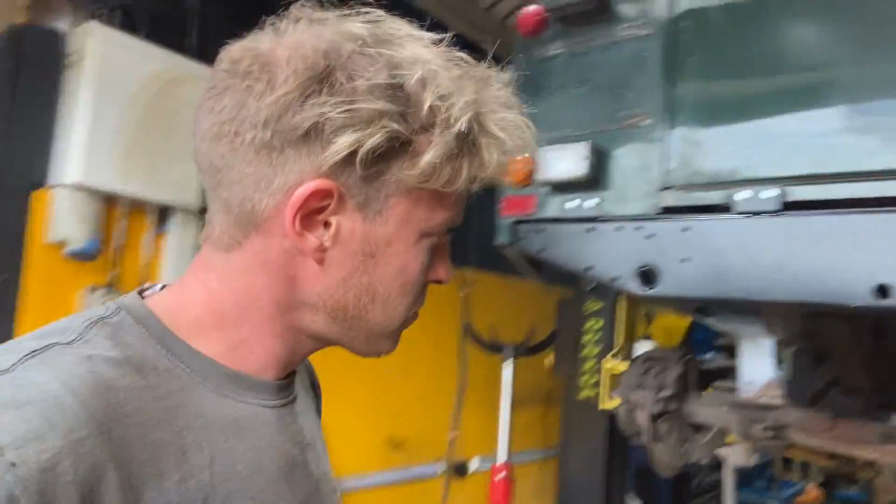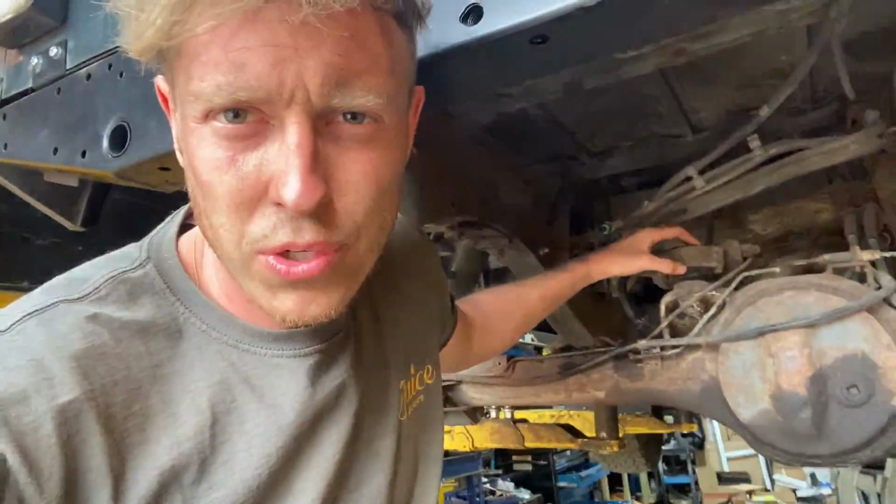We've still got to do, so I noticed, actually, I want to change the A-frame ball joint, which stops the axle rotating forward and backward. The gate is completely just trashed. So I want to change that. Obviously, our shock is snapped on that side, so that's great. We're going to be putting that stuff on anyway, but for now, I'll probably just assemble it and sort of not have a shock. It's not going to be driving on the road, but it'll just be moving around the yard. And then basically, it's pretty much time to have some fun with this.